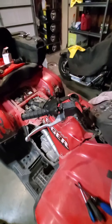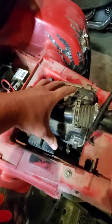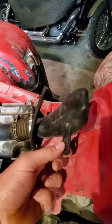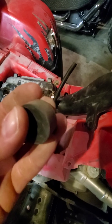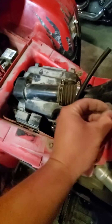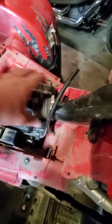This shift knob here is going to have two holes on the front with two small screws right there. You're going to remove that, then remove the airbox — there are two clips that you pop here and here. It lifts this way and slides out. Be careful, these tabs can be brittle. Undo this bolt that goes right here, which has a little grommet that it sits in.